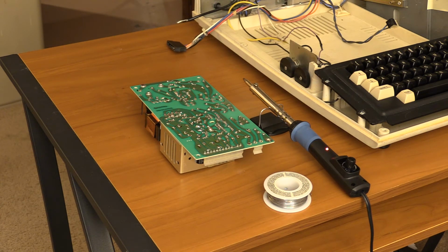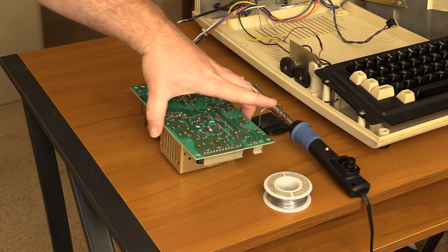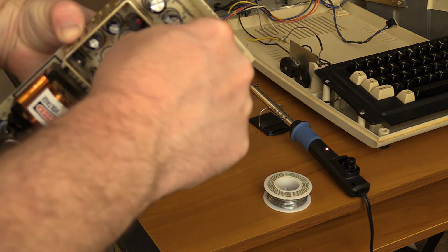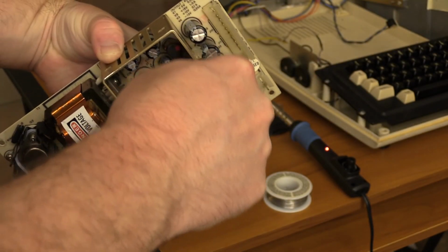And the way that I figured this out, I pulled it apart of course, and the CRT didn't work. And after making sure the tube was okay and there were no shorts or smells or anything, and there weren't, I was racking my brain to figure out why it didn't work. And when I powered it on and put the meter on the 12 volt lugs, to show you how this is, these two here, the V2 and common in V2, that is the CRT.